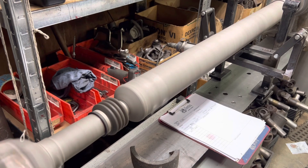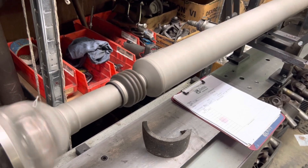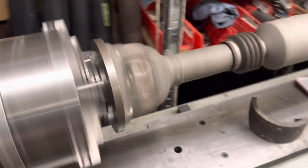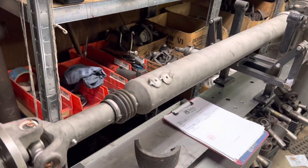Next stop is paint, but we're going to crank her up here — that's about 2800 RPM, zero vibration at the transfer case. It's bobbing a little, maybe half a thou, with the rear axle, but there is no energy there at all. So we're going to call this a home run for Rob's customer and get it painted immediately so they can get it back this afternoon.